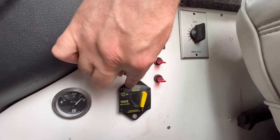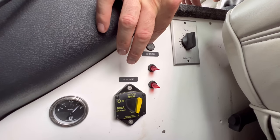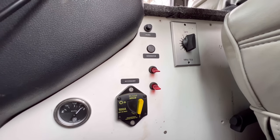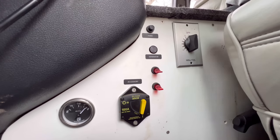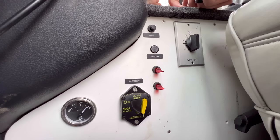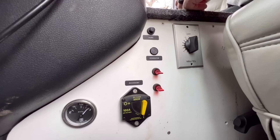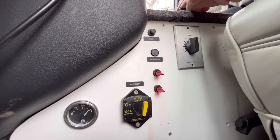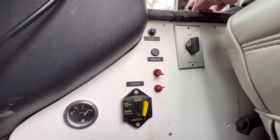On the driver's side of the console there's a 100-amp circuit breaker controlling all accessories up front and a magic button that lights up green. There's a secondary alternator installed that puts out 280 amps directly to the battery bank, so you never have to plug the van in — it charges itself along with 380 watts of solar. There's also a train air horn right here, and this works for onboard air — the van has an onboard air compressor and a tank in the back.